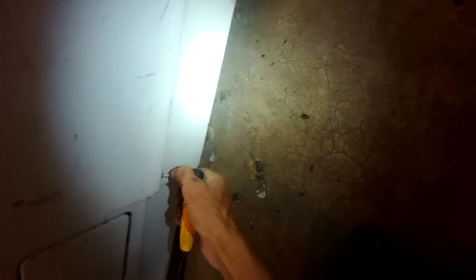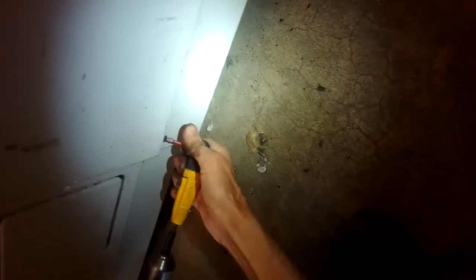I'm spinning out the two Phillips head screws on the lower part of the front panel — I want to remove it so I can see what's going on during the spin phase. I'll pull the panel out toward me to about 45 degrees, which releases the upper clip. Yeah, it looks pretty corroded down there, a lot of rust.